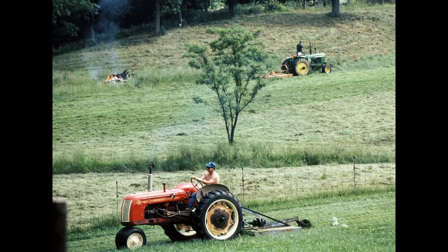So I decided to tear into it and see what it was. It was the rings — the oil rings were the three-piece design where you have two thin ones with an expander ring. With the connecting rod loose, you could just take the whole piston assembly — cylinder heads off — and slide it down just like gravity, and it would go right past the oil ring and land on the first compression ring. They were just completely worn to where that expander wasn't holding it out at all. Easy fix: I just used a glaze breaker and cleaned up the liners, didn't change the liners, new set of rings, just lapped the valves. It's run great ever since. Now I go literally years without changing the oil without it getting any color because I put so few hours on it — and never have any trouble with spark plugs.